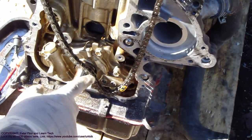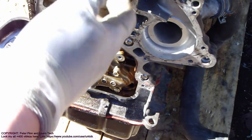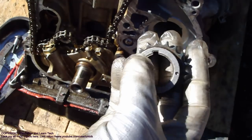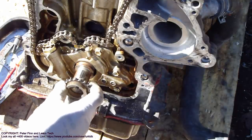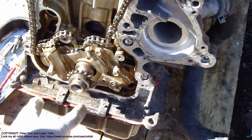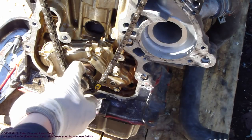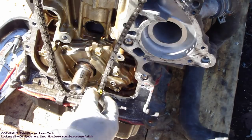Okay, and then we go to this crankshaft area. There is one sprocket that I need to install in here, and it goes not in this way, and this is the right way, and that hole goes to this point. Then I only move that carefully, and if this doesn't go in, a little bit of oil, and then it moves. I insert that only to that point. I don't press that totally in here, because this chain adjusting is very complex. Now there is one point in here, and this point must fit to this yellow mark.